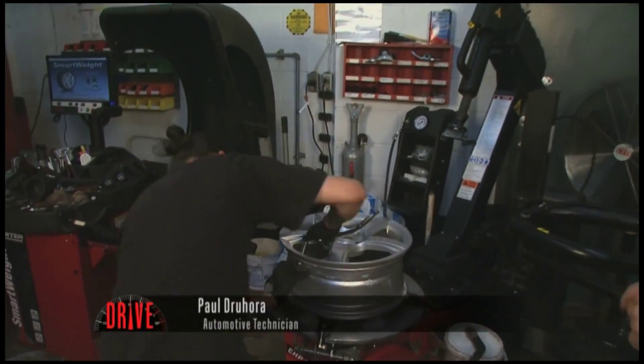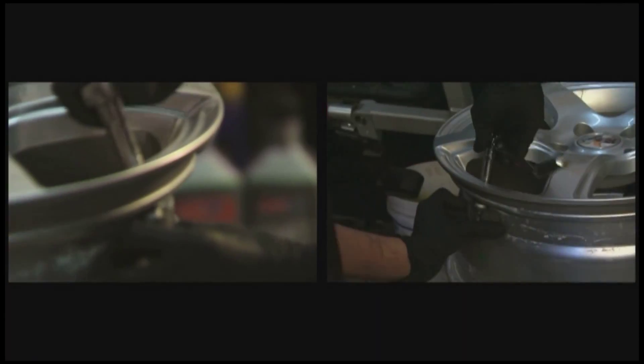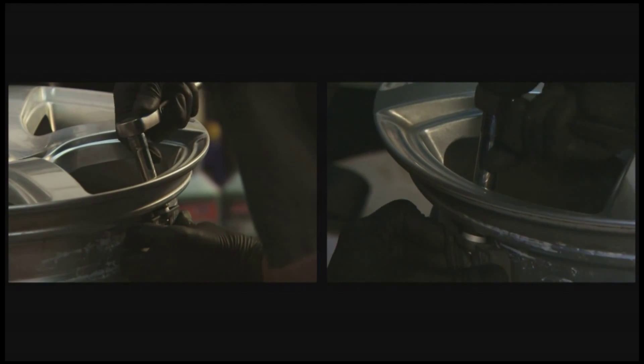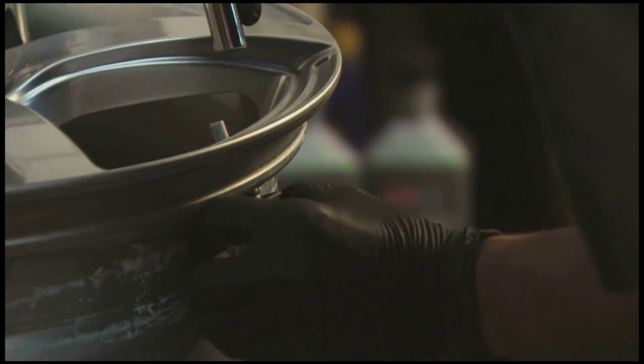There is a proper seal on that sensor. The rubber seal on this sensor is identical to what's on a regular tire valve. That seal needs to be replaced every three years, so just remember that every so many years you have to service these just like you would a tire valve. The rubber gets hard and old and it just starts to leak.